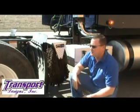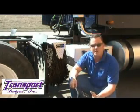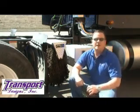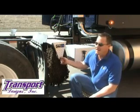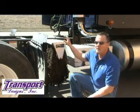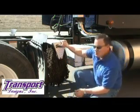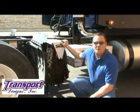Here, I grabbed a truck from the yard. It's 103. I didn't really look at the chain box until I got over here to where we're going to film, and I made a critical error. This chain box is held down by a 9/16 bolt. If I didn't have tools on me, I wouldn't get my chains out. And you don't want to learn that problem at 2 in the morning when you're sitting on the side of a mountain. So make sure and look your equipment over.